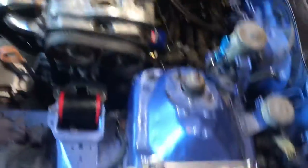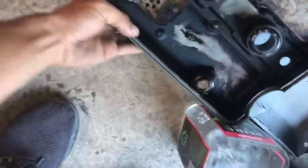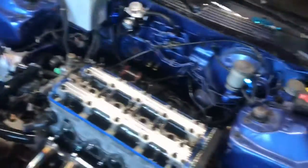We're going to fix it before it gets too bad. The car hasn't really been driven like that. But we just gotta fix this overheating issue — hopefully the head gasket will fix it. We just got the distributors disconnected, and everything's pretty much disconnected from the head. All I have to do is take the valve cover off — which I already did — and start taking the head apart. Everything looks good in here — Super Tech oil in there. So we're going to go ahead and get this apart and make an update once we get the head gasket off.